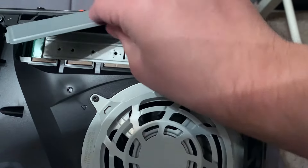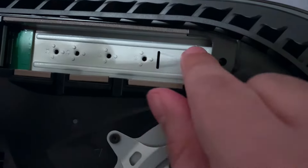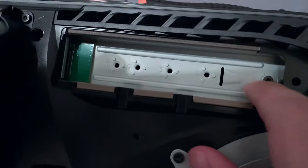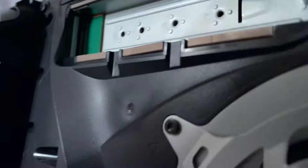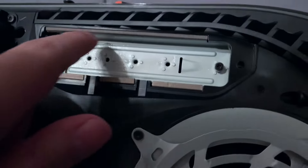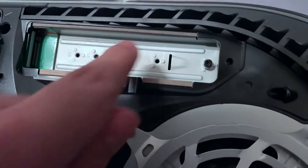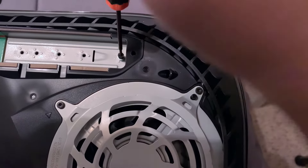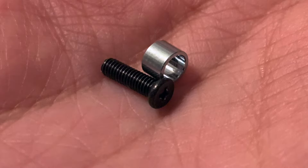Then lift this and you see this area — this is a screw head that you unscrew with a washer. You're going to place the SSD inside here; it's going to basically plug in. Once you secure it, remove the washer and screw and put it into one of these notches. Find the right screwdriver for the screw here. Once you do that, you should have a tiny screw and a secure washer.